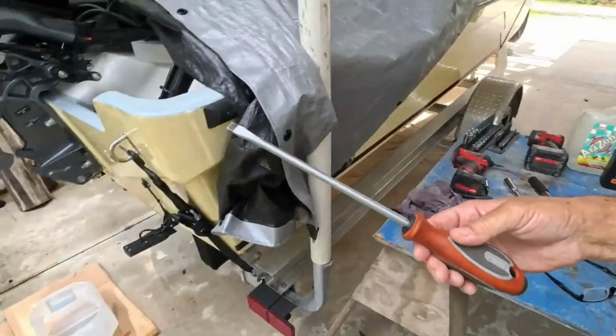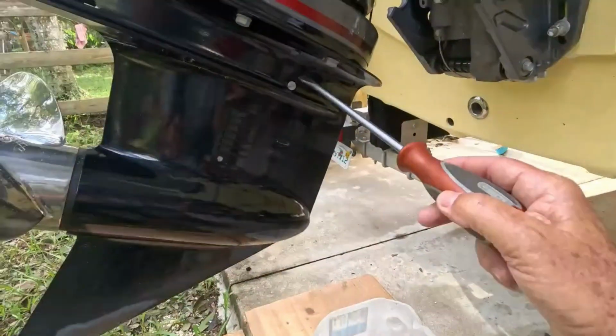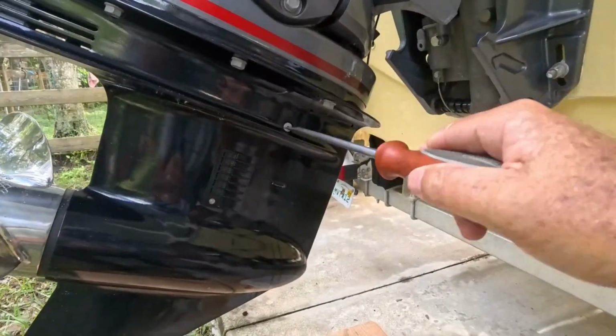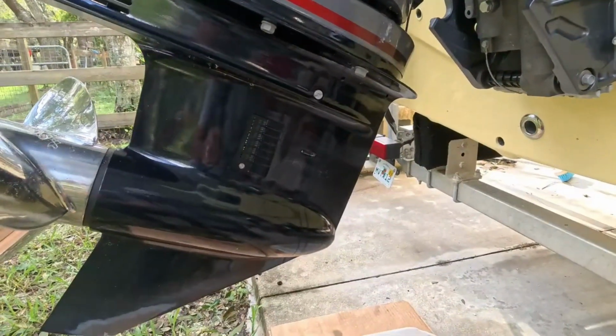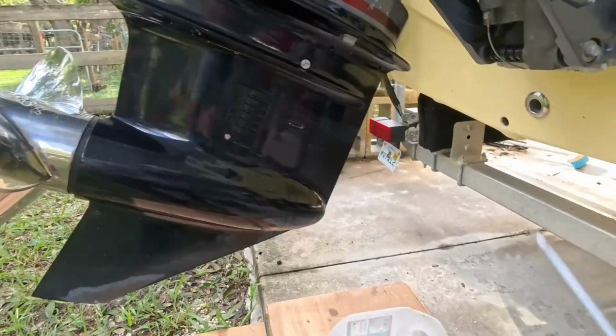A large, common screwdriver. And this is very important. You want one that fits these screws perfectly. They're tight. They're real tight. And if you booger up that screw thread, you're not going to be happy, because then you need a little impact screwdriver to get it out, and just don't mess them up. Get the right size screwdriver.